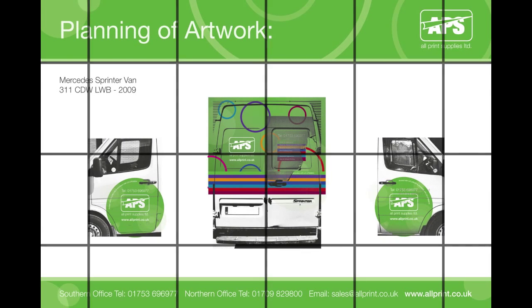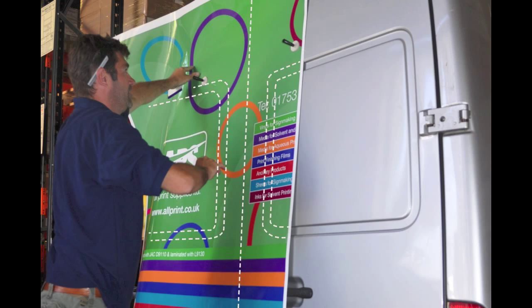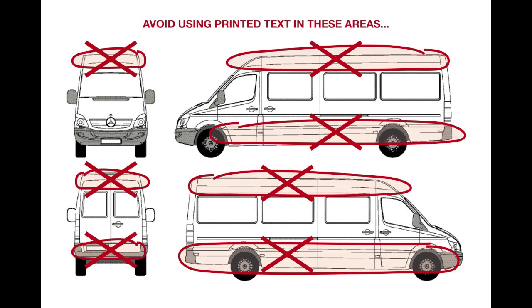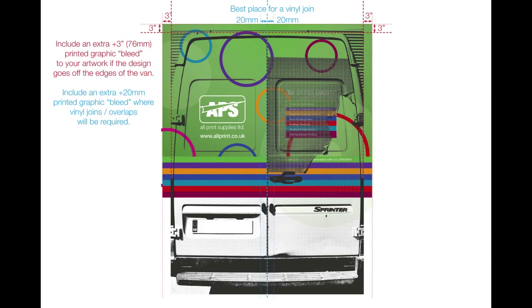Check the size of your printed vinyl sheets and that they are optimised to cover the intended vehicle surface. Your design must effectively consider the creases and contours of the vehicle. Carefully consider where any overlapped vinyl areas and joins are to be made when planning at this design stage. Try to avoid using printed text above the rain gutters or below the bottom swages, as these areas can be more prone to stretching while fitting, with the possibility of then appearing out of shape. We recommend you use CAD cut vinyls for text elements and apply these on top of the vinyl design afterwards. Leave enough bleed where vinyls are joined on the vehicle surface, and try to plan joins in areas such as rain gutters, swages or panel edgings.